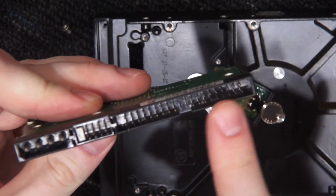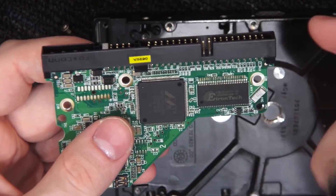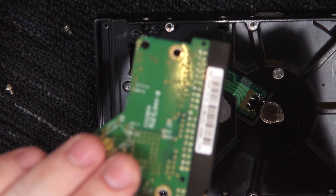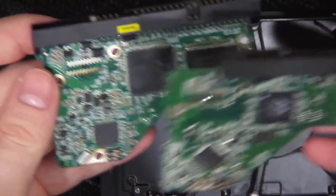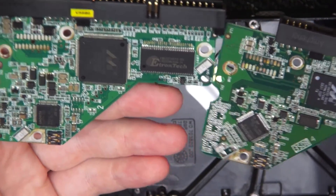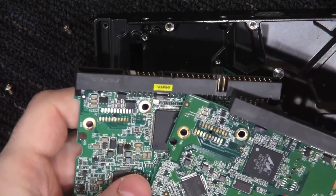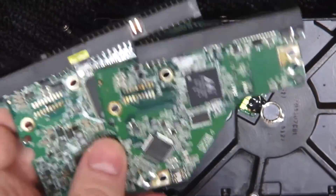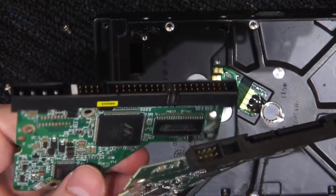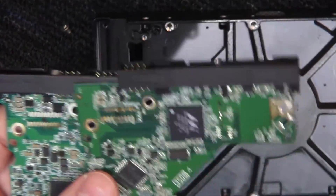This might just be the same controller type, and this might be a breakout for IDE — hard to tell, we'll look it up. This is the same mass-produced part; it's actually a Foxconn brand, while this other one is not. It would be interesting to know if you could swap driver boards just to change the whole interface, if you had more similar platter layouts. Obviously there might be quite a big difference between these two drives with different platter layouts, but on much more similar models, I wonder if just switching the driver board would work, or if the layout contains some sort of calibration data that the drive reads in and figures out.